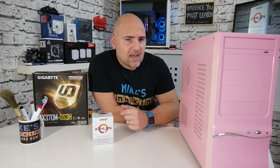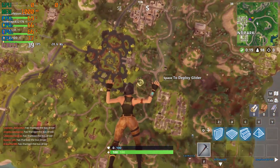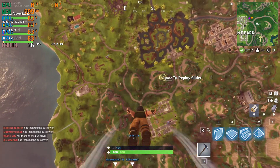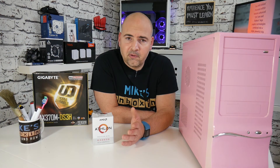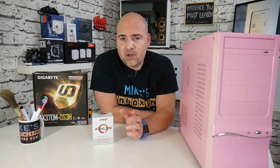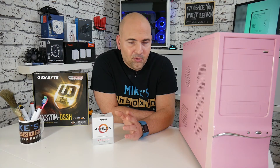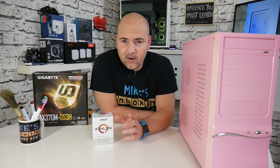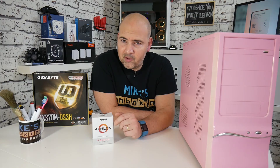So we've done a selection of games. Starting off with Fortnite — I tested Fortnite in an 8 gig configuration and a 16 gig configuration just to see if there was any benefit, and there was a noticeable benefit for the dual channel. So I then stuck with 16 gigs for the rest of the testing. All the games apart from the very first one will be with 16 gigs in dual channel mode, so if you're wondering why the figures are looking a lot better, that's probably the reason why.